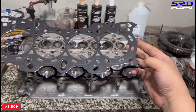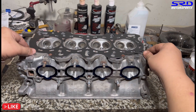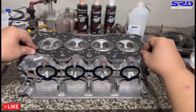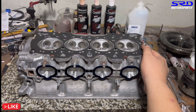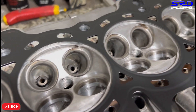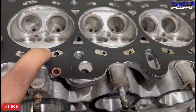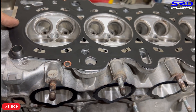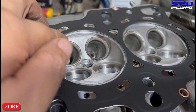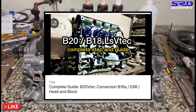With the dowel relocated to the intake side like the B20 non-VTEC, we put it back in — re-drilled by my colleague. As you can see, the bore is 84mm so it's way bigger than the chamber, which is perfect for the block. After resurfacing, this edge becomes really sharp and prone to pre-ignition. On all the B20 VTECs we do, if we don't counter-bore the chamber, we round off those edges. Locally some replicated a build but ran one second slower because they skipped this step.